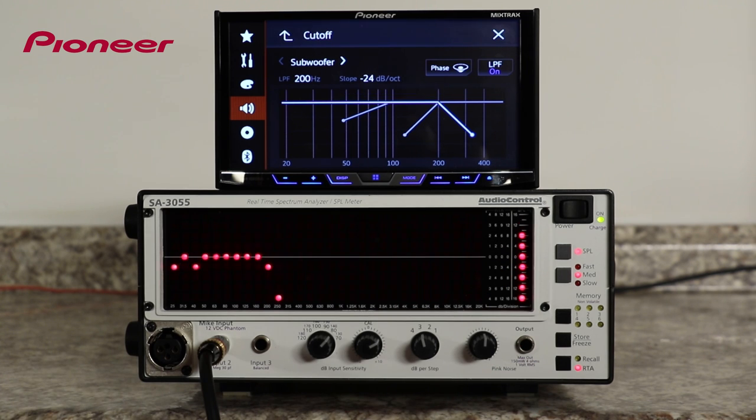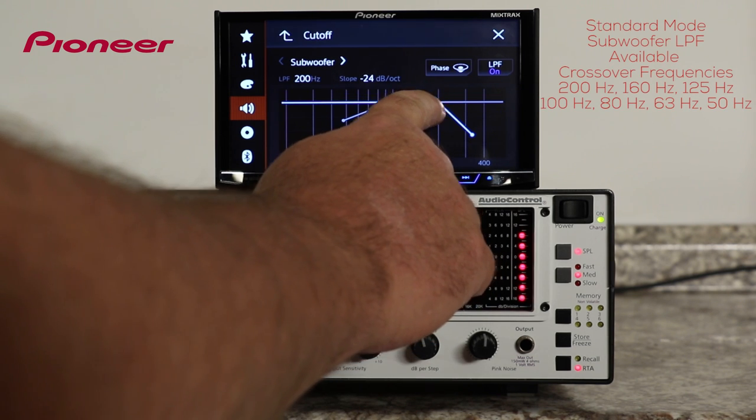This is exactly what I want if I have a subwoofer in my system. I want the high frequencies to go to my front and rear speakers, and I want the low frequencies to go to the subwoofer. We can change the crossover point from 200 to 160